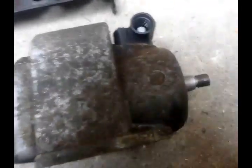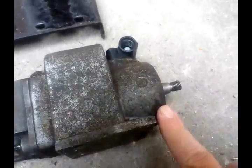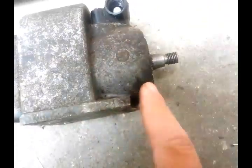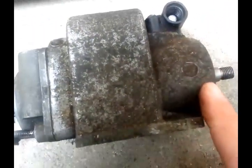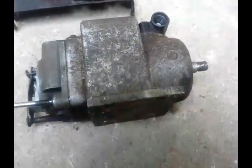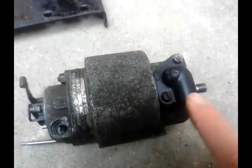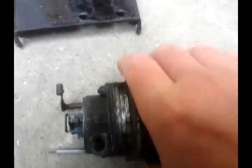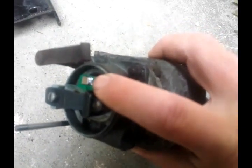However, the original capacitor is obviously still in there. It's not a capacitor in the modern sense of a plastic or equivalent type. It's lurking in this end on this particular one. Somehow we need to get this thing apart and disconnect it, because looking at a circuit diagram for one of these, it will probably be in parallel, and even if there's some capacitance in there, that will obviously affect the total capacitance.